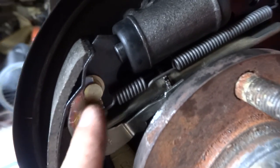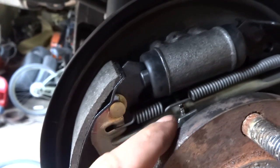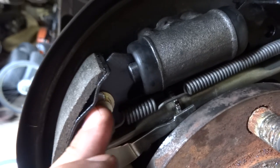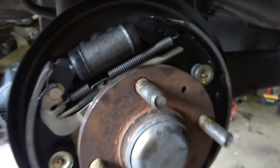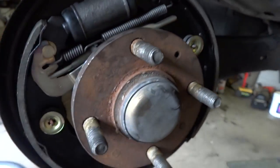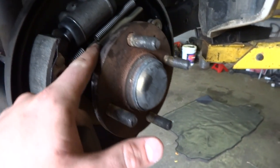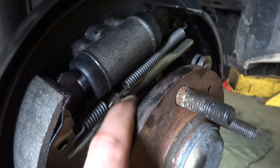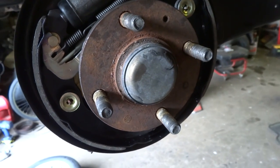Here's how it all looks. We've got the clip-in spring here — you have to push and hold this part down because it doesn't want to go all the way in on these new pads. So this is how it looks. Next we've got to just adjust it once we put the drum on. Spray a little brake cleaner on here, then fit the drum on, put it on, see how it feels, and then get a flat head and keep ticking down on it to adjust the pads to where we want them to be.